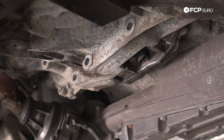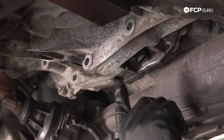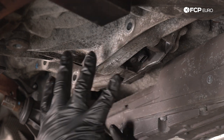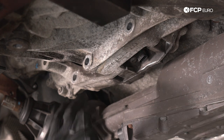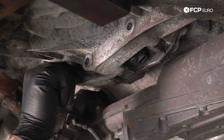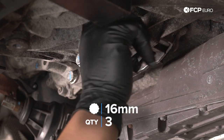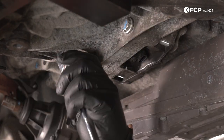We have the transmission made it up to the engine nicely. For now we're going to start the bottom three bolts, then move to the front starter and the bolt right by the electronic steering rack, just so that everything's nicely sandwiched and we can lower the trans once more to do the top. So first, three bell housing bolts going off of our diagram that we made out of a pizza box — we're just going to start these by hand. These are the 16-millimeter 12-point bolts.